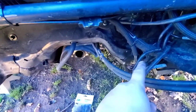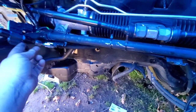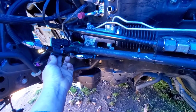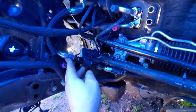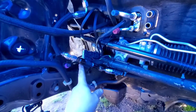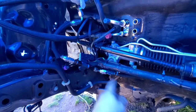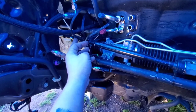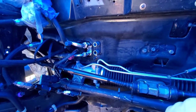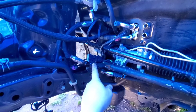I got my return line right here, and it's hooked up to the flex fuel sensor — that's where I'm going to mount it. I'll zip tie all this to the bar. I connected the signal wire and the ignition wire and fed it back through the hole. I'll run it along the inside firewall to the driver's side and show you guys where to tap it in. That's how I'm going to run my flex fuel, keeping everything away from the exhaust and turbo manifold heat.